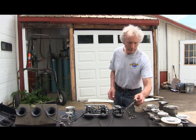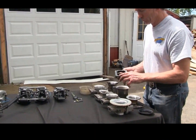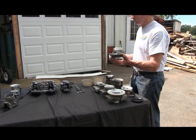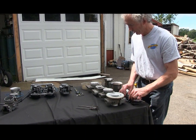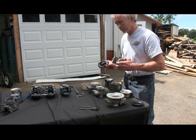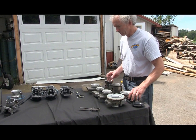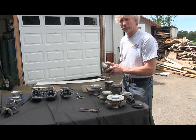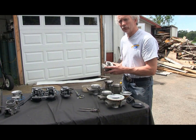Now let me go to different carb shapes and sizes. The interesting thing is if you look in a V-Force reed or most reeds, you would think this oval or diod carb would be the way to go — just logic or common sense. A crank shop has a big 59 oval. What we found in dynoing — and I'm not an air flow engineer, so I really can't explain it — this round carb going into a manifold which splays out to this shape will make the same power as a diod when you're comparing size to size. So don't get caught up in the hype. A lot of guys asphalt racing this year bought a diod and found out — they didn't go any faster. The beauty of the diod might be with the smaller tubes in winter: when you're getting that wide temperature variance, your jetting may not vary as much.